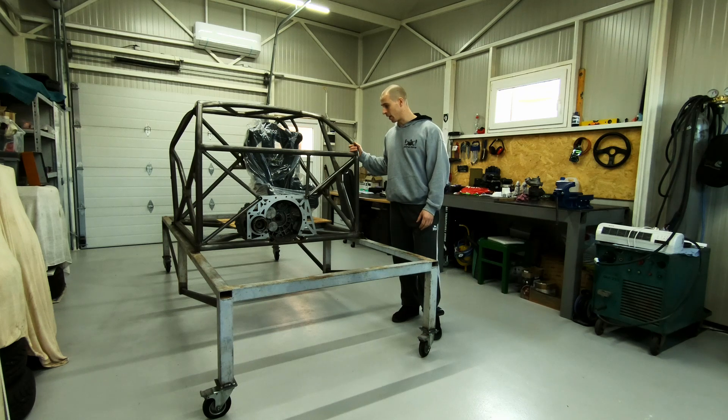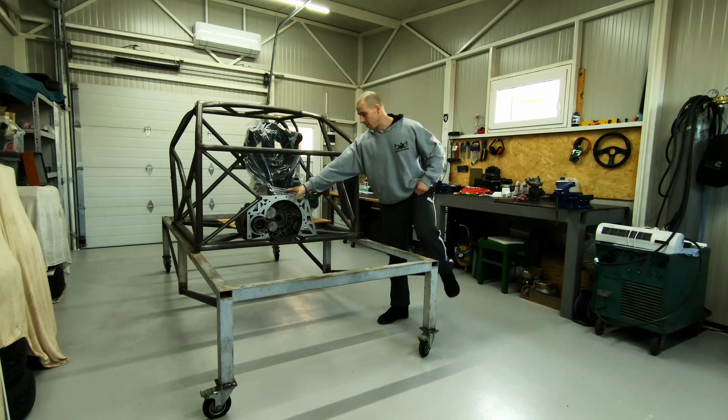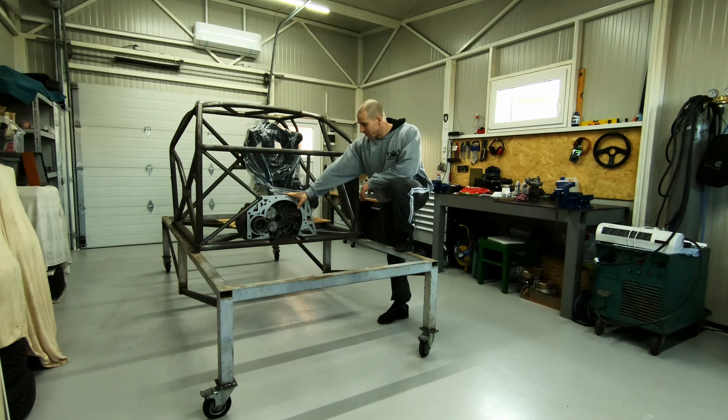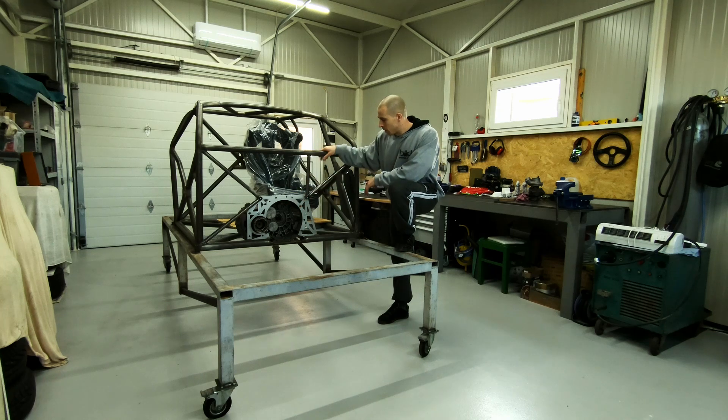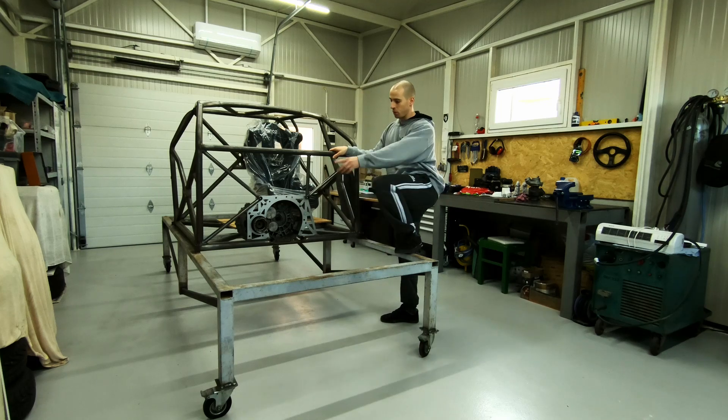About the drivetrain — the drivetrain will be VW-based. What you see here is actually a VW gearbox from a Golf 5 2.0 TDI engine. The code of the gearbox is 02Q, which has a slightly better casting than the 02M — a very famous gearbox in VW. This is actually a front-wheel-drive gearbox and I mounted it longitudinally, so the differential output shaft will be connected to a shorter front drive shaft and a longer rear drive shaft running to the front and rear differentials.